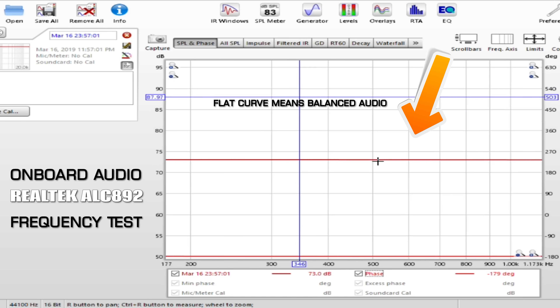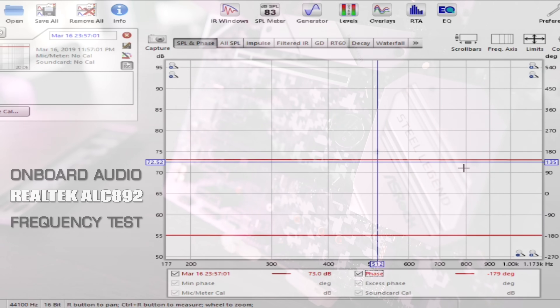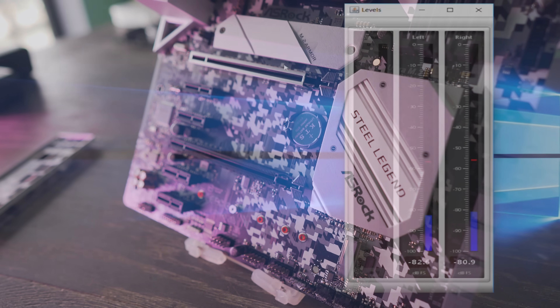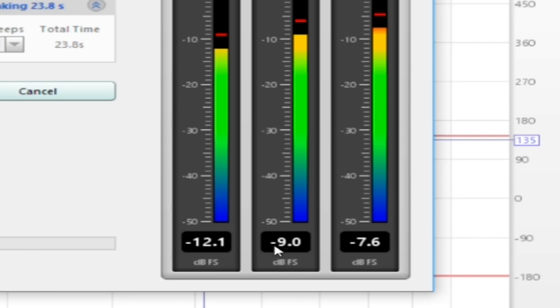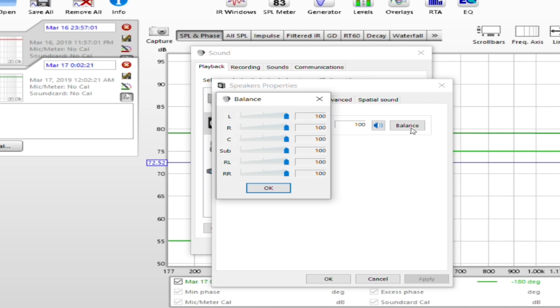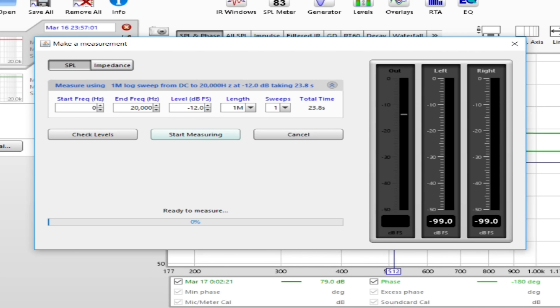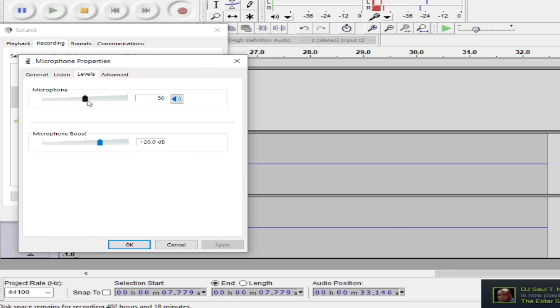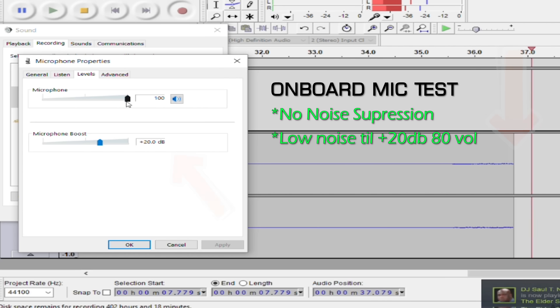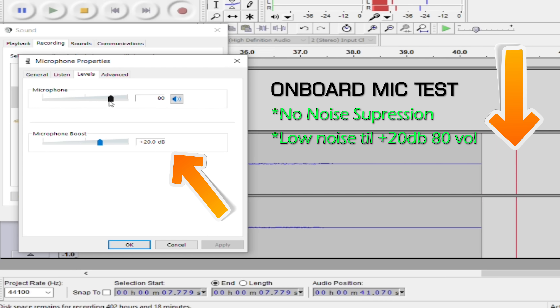No imbalances in the frequency response. This solution is going to serve you well for audio listeners, competitive gaming, or music listening on a budget. The crosstalk levels were phenomenal all the way up to volume level 100 — no leakage on either left or right channel, at about minus 80 decibels of crosstalk, which is very good for stereo listeners. One thing I did notice was about a 1.5-decibel difference in balance between left and right channels, but this was easily corrected by dropping the right channel volume in Windows down to 90 versus 100 on the left. ASRock have also doubled down on the audio input — the mic-in port — and they're not using noise suppression, so your voice comes through very clearly up to plus 20 decibels at volume level 80. After that it did introduce some noise, but these levels will be fine for pretty much any mic headset out there.